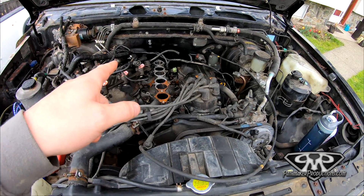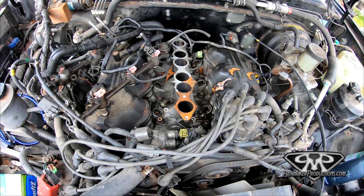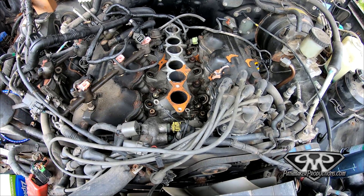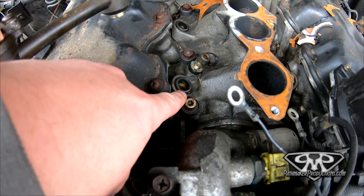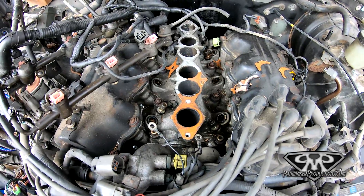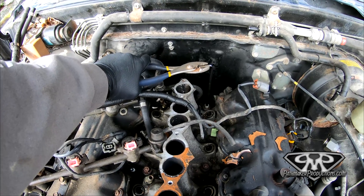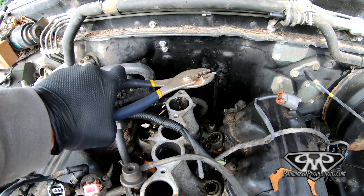Since I seem to take months to do every project, this is where we left it last time. I'm right at the point where I gotta pull the intake manifold off. If you're doing this and you care about the motor, you don't want the orange gaskets to drop down in there. But since I couldn't care less and this block is going, I don't really care. When you break your socket Allen head, you get to do fun things like put a pair of pliers on the end of the Allen key to try to pop the bolts.